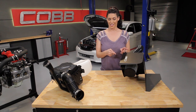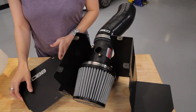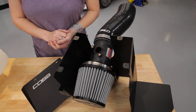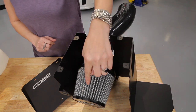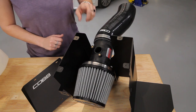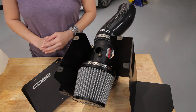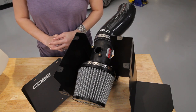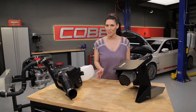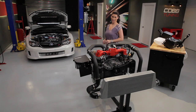When you're ready to kick it up a few notches, you can replace the entire intake and airbox. We still have a box to shield our intake from the heat of the engine bay, but the panel filter has been upgraded to a high-flow cone filter. The filter is then connected to a MAF sensor housing, and finally there's a silicone post-MAF hose which is much smoother internally than the stock plastic part — this will make for less turbulent airflow. Not only have we reduced quite a bit of weight and bulkiness, but it looks a lot better too.